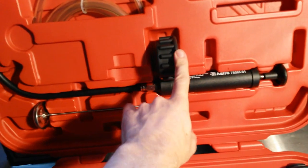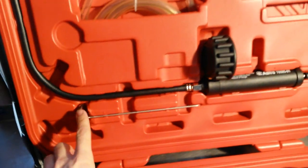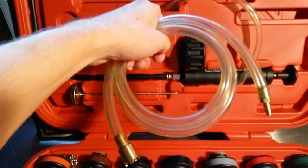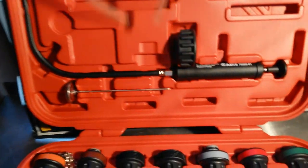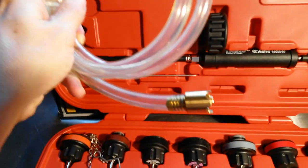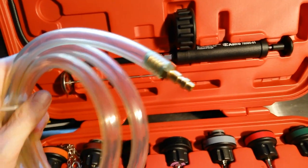Let's take an up-close look here. In the top half of the kit you get the cap tester and the pressure tester with quick connects — everything's got quick connect. It does have a pressure relief valve on it, you get a thermometer, and you get your fill and drain hoses. That's for sucking coolant out of a bottle when you're filling a system, and that's your discharge hose. Pretty nice brass fitting on there — I like the way they did that. It's got a screen on it with a little snap ring and quick connect fitting.